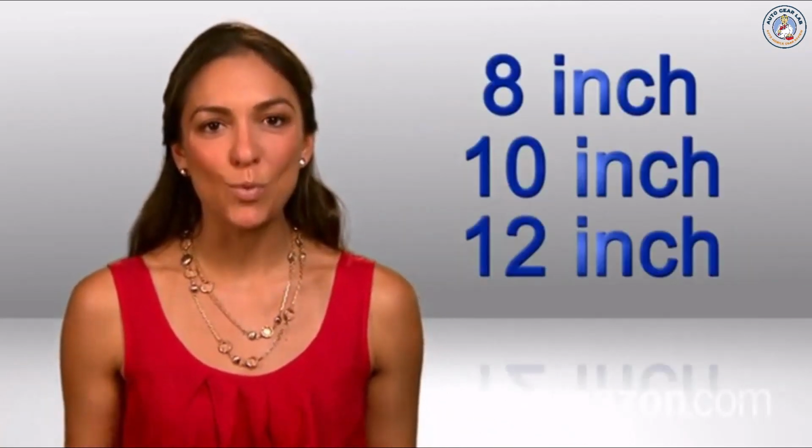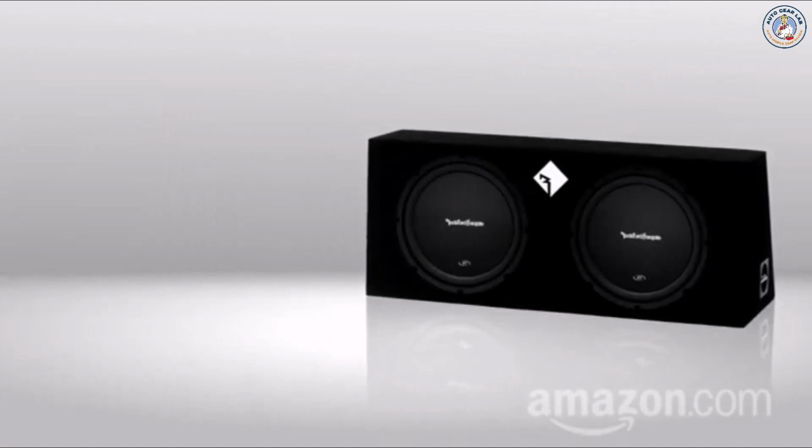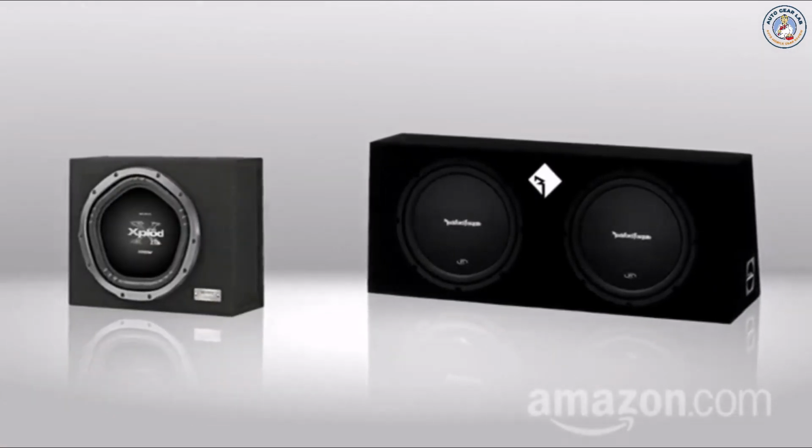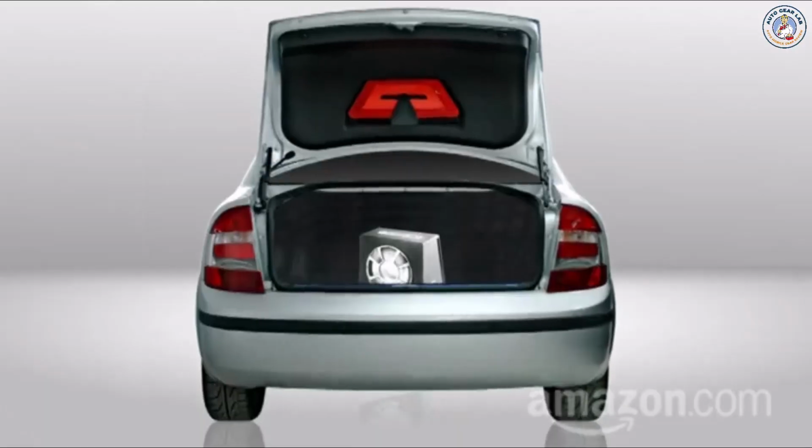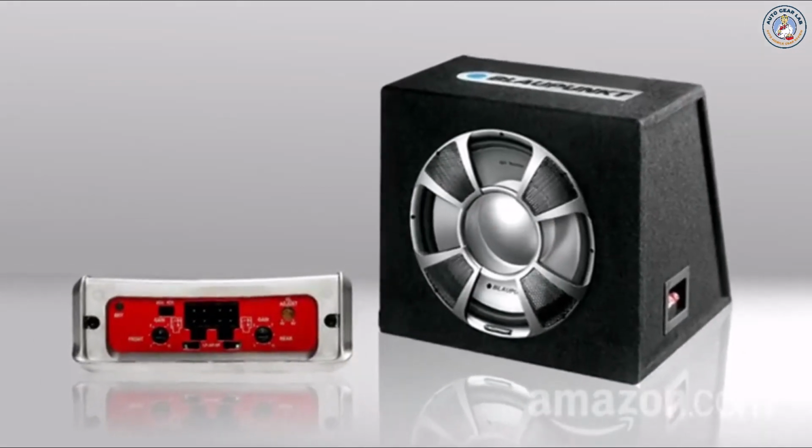Most subwoofers come in three sizes, 8, 10, and 12 inches. Some have the amplifier built in, but some don't. Make sure you get an amp if your sub doesn't have one. Now match your sub to your music preference. A smaller sub is often in a wooden box with a speaker on one end, fits in the trunk or under a seat, gives you tight, accurate bass, but needs a powerful amp to drive it.